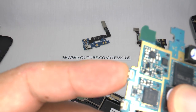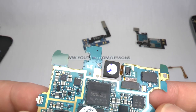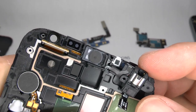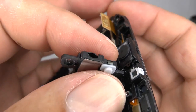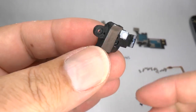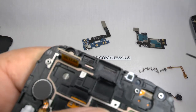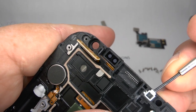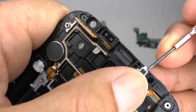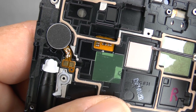The volume up and the volume down keys are replaceable using a hot air soldering iron. If you need to replace your headphone jack or your earpiece, then gently lift up your headphone jack and lift the earpiece out of the case. Just double sided tape holding it on and it also contains your power LED. You might need to transfer this small rubber gasket for the secondary microphone over to your replacement screen if it doesn't come with that. It can't go in the wrong way because it has a little tag on one side. This is the heat sink compound for your quad core CPU — make sure that's on your replacement screen as well.